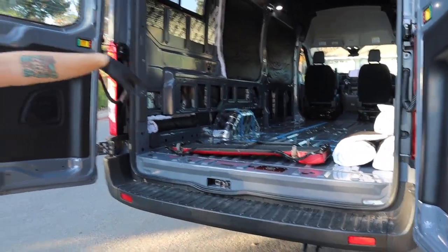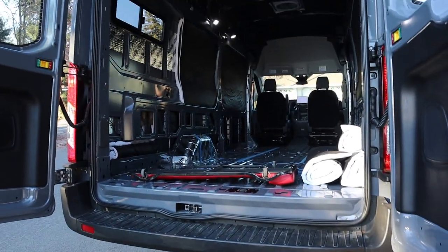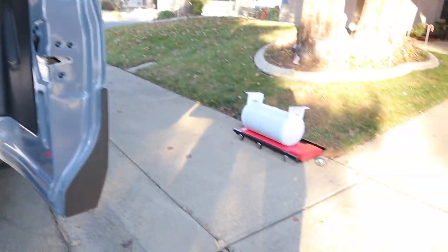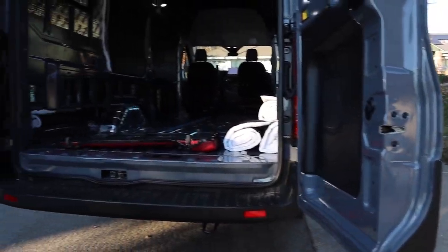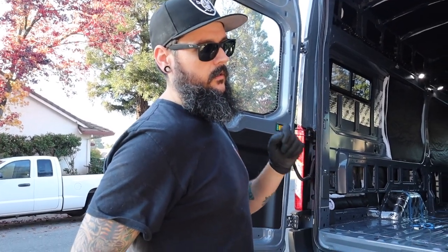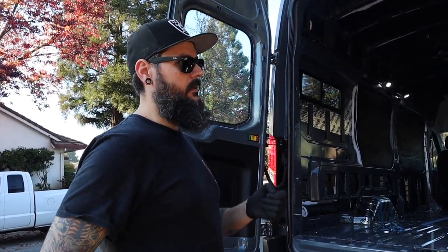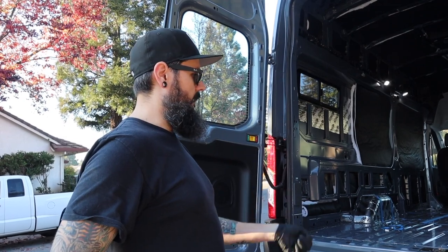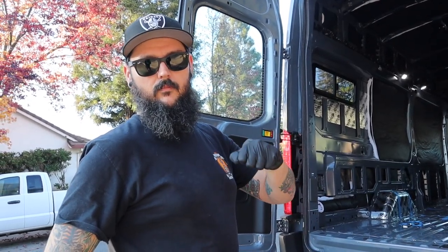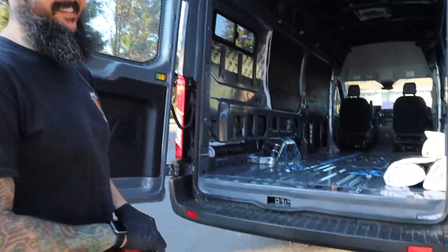I've got the bars and the bolts in place inside the holes. I've put the van on ramps and I've got two creepers — one for the propane tank and one for myself. I'm going to slide under the van, jack the propane tank up with a jack, get it into place, and then loosely fit all the nuts on the bolts. Then once they're in place, I can drop the van back down, pull all the stuff out, and have someone climb in the van to hold a wrench on the bolts on top while I tighten them from the bottom. Should be fun.